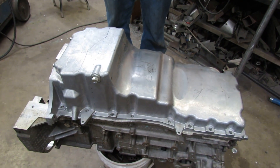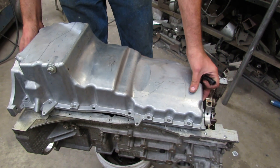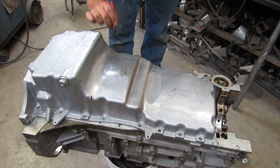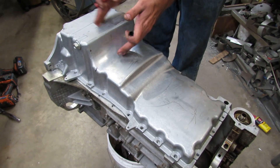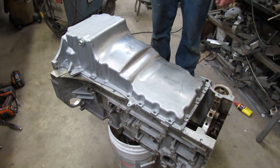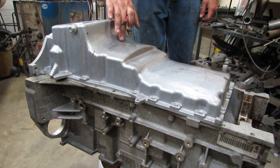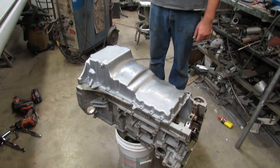In this case, we don't have room for a very wide sump like that. We need a sump that's very short. What we're going to do is cut here and all the way across, then extend this shallower section — it will be like this — and that will fill the gap. We will retain the smaller oil sump, though we may extend it a little bit to get the oil volume.